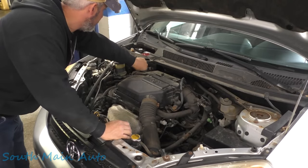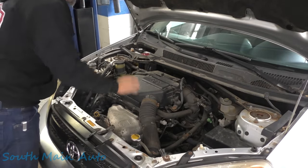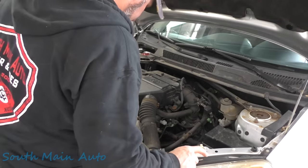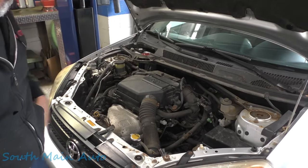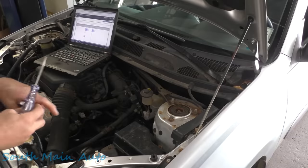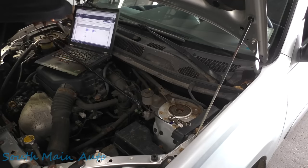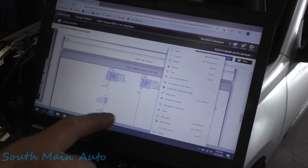Looks like there's a big junction of wires coming out of here, out of the battery post. The battery's relatively new — the guy doesn't have any history on the car because he just bought it. So let's focus on the radio there and see what it takes to power that up. I'm assuming we have a whole part of a fuse box that is dead — that's my big fat guess. Got a test light here, we're going to clamp onto a good ground, make sure our test light works — and it does. I've pulled up the wiring diagram here.